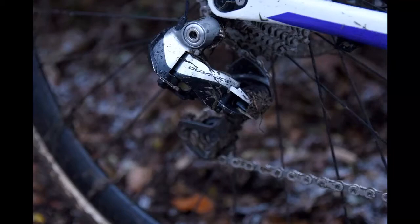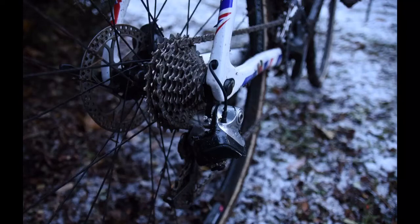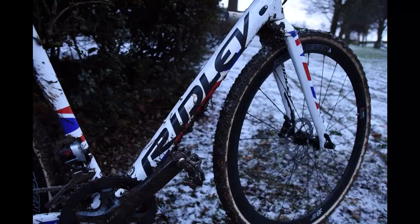You've been riding cross for a while — what is special about a cross bike and what does this one do that others don't? The Ridley's a really traditional setup with a really high bottom bracket, fairly short top tube compared to a road bike, quite a big seat tube to make it easier to carry. Apart from that, they're pretty much similar to a road bike.